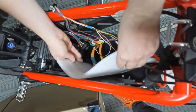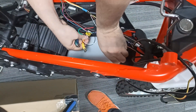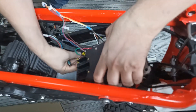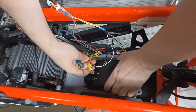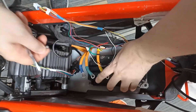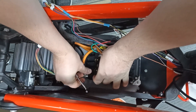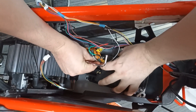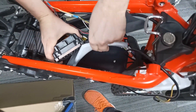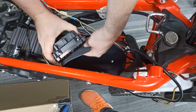Put something soft on the bottom for protection. Remove all wires except for phase wires. Put the controller on the soft material and, without securing the controller, screw in the phase wires. After that, bend the wires so they don't cause too much strain when bending. Next, you can cover the phase wires in the kit with the lid. Put the thermal pad underneath the controller and don't forget to remove the protective material covering both sides of the thermal pad.